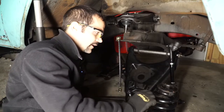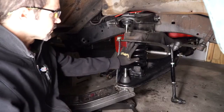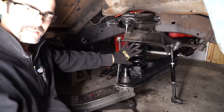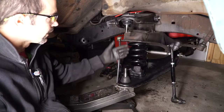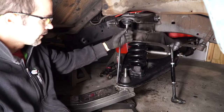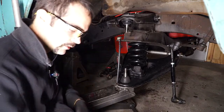We're going to set the coil spring in. Our spring is currently under tension — there's a pocket and kind of a ring that this sits in, so you've got to make sure it's set in the right way. We've got our lower ball joint, which we're going to set our spindle on. We'll put the nut on it, raise it up to the upper, put the nut on that, then get our shock on, release the jack, and go from there.